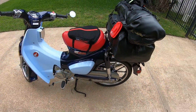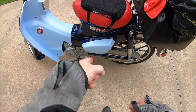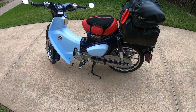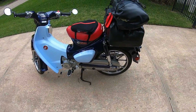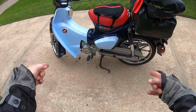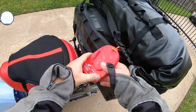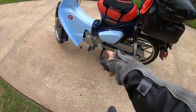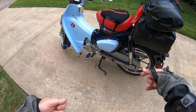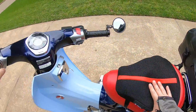$100. So if anybody's wondering what I've got here, I fashioned up a center stand puck system because we don't get a side stand, and it's supposed to be rainy and nasty in Austin this weekend, late tonight through tomorrow morning. It's our typical rainy weekend thing that we haven't been able to shake out of for almost 5 months now. It's going to get muddy there, so the Cub not having a side stand, you don't have 3 points to support and one single puck to help widen that out. So I just Siamese two of these guys together with some paracord, spaced them 5 inches apart, which fits the width of the center stand pads down there pretty well. I just lay them down in front of where I think the center stand is going to be, roll the bike forward a little bit, step on it, and lift the bike up. Works like a champ.